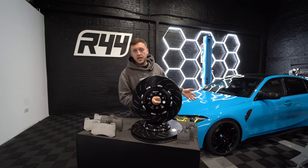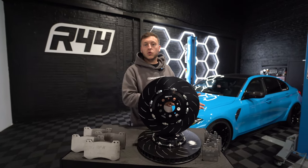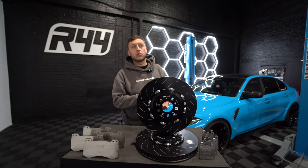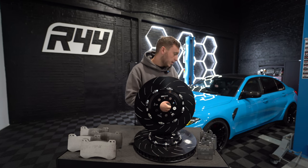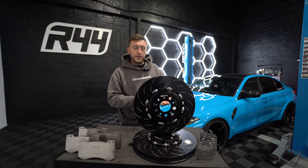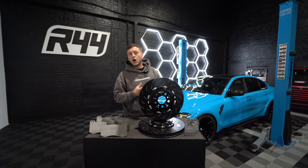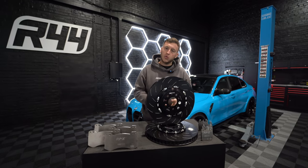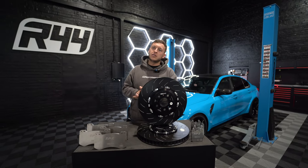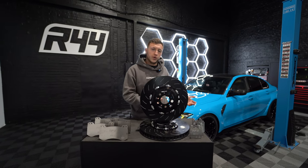The front disc on the G80E is probably because of my hard braking, my poor respect for the car. But all in all, we just kept having issues. We replaced about three sets of discs straight away within the first two months of owning the car. That was primarily because the OEM discs — the way they cool down and hold heat isn't the best, and the materials cause a lot of warping. You'll feel a vibration when braking at around 60 mph — that is a warped brake.